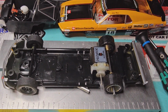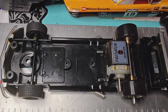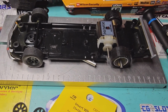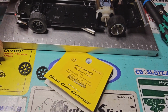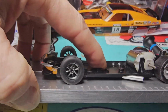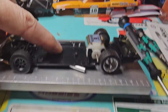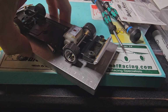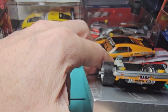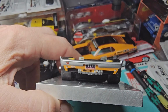Now for this exercise, they're literally just sitting on there. I haven't snugged them at all. They're just sitting on top of that axle. I had a 60, so whatever, it's going to get trimmed. The idea here would be to check your contact patch, and make sure that everything is sitting flat at all angles. So take it and come around from the back side as well. Don't shove it down too tight, but you want to get underneath there and check that contact patch.